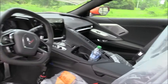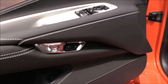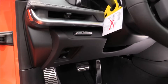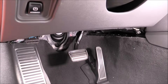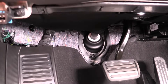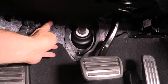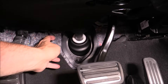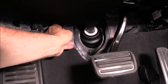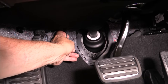Just because you have access to the interior of the car, you've still got to get to the frunk because that's where the battery is, and with no power to the car, the electronic release is not going to work. You manually have to open up the frunk, and that can be a little bit of a task. Way up underneath on the driver's side, you can see way back here there's a cable — a little loop. It might even be tucked behind there. Grab that loop and pull it hard two times — not just once, two times — and it will manually open up that front trunk.